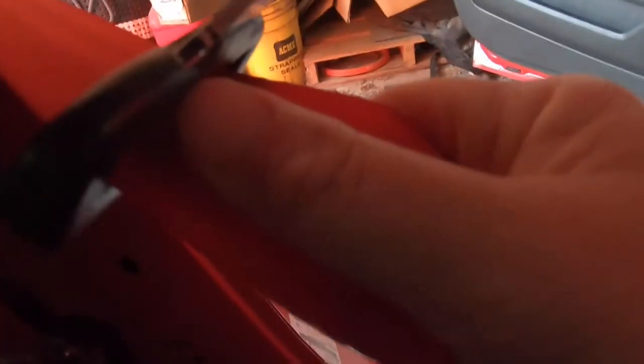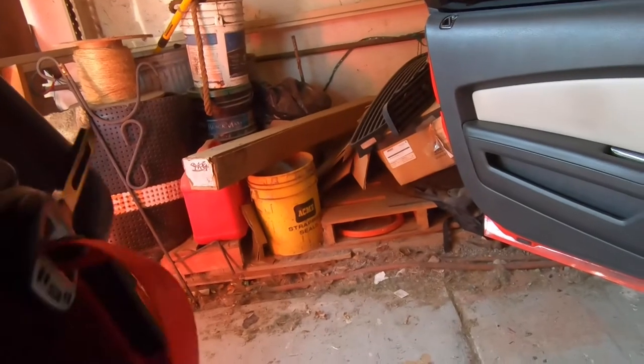So I got the red seatbelts in but there are a couple of problems. Sorry for the bad lighting, but as you can see I have this installed but there's way too much slack. The problem is it can't retract back because this little black stopper is too far up - it should probably be an inch or two down on the belt because it just hits the retractor housing. Everything else installed correctly on the driver's side, but I've got to send this one back so they can fix it.